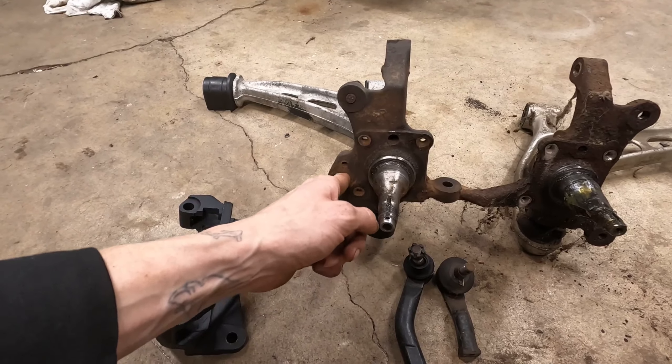Pretty straightforward — there's a seal down in here, it's going to be a square-cut o-ring. Obviously you want to lube everything with brake fluid — we'll lube everything with DOT 4. Get the little spring retention in that holds on the boot, and then screw in the actual piston. Real quick and easy. Then we'll mask off the pistons, sliders, and springs, and paint everything.